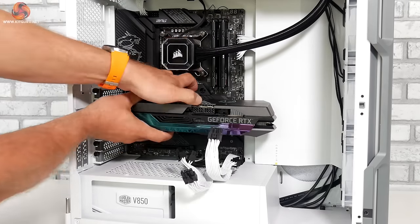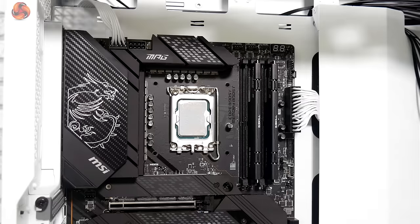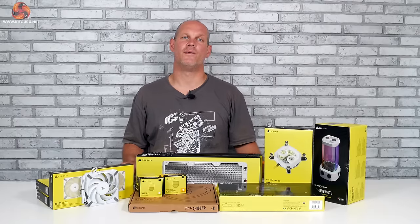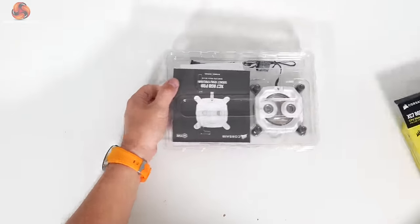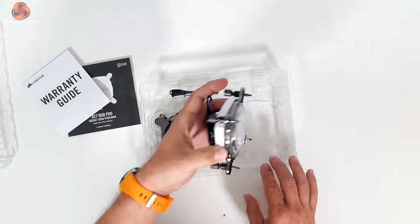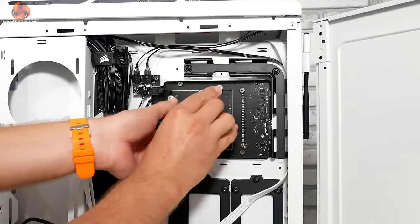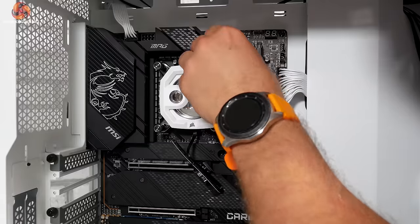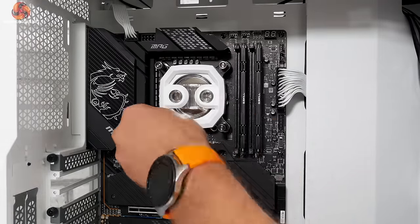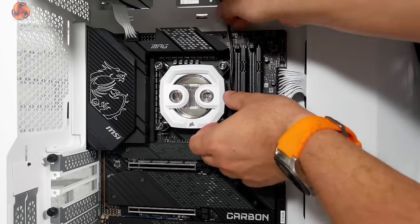It's time to build out our system. First I've removed the graphics card and taken out the H150i Capellix AIO, and given the 12900K a good clean to remove the old thermal paste. The XC7 has more than 110 micro cooling fins — the more surface area within our CPU block, the more heat can be removed. The XC7 is compatible with most common motherboards and CPUs for both Intel and AMD platforms and comes with thermal paste pre-installed. I install the CPU block backplate and then get the block fitted, tightening in a cross pattern to finger tight only to prevent any damage.